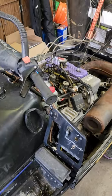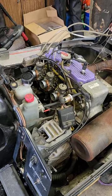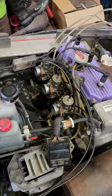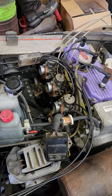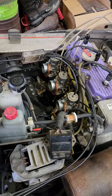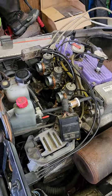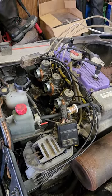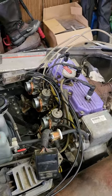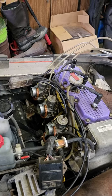Working on a '93 XLT Special. Went back through the carbs, put a little bigger pilots in it. I've already static synced the carbs to get it to idle about 2000 RPM, and I also adjusted the air screws. Now I'm going to synchronize the carbs, verifying the airflow through the three carbs is equal.